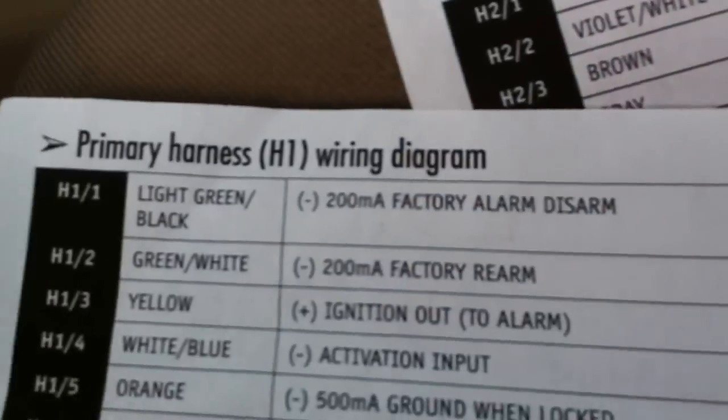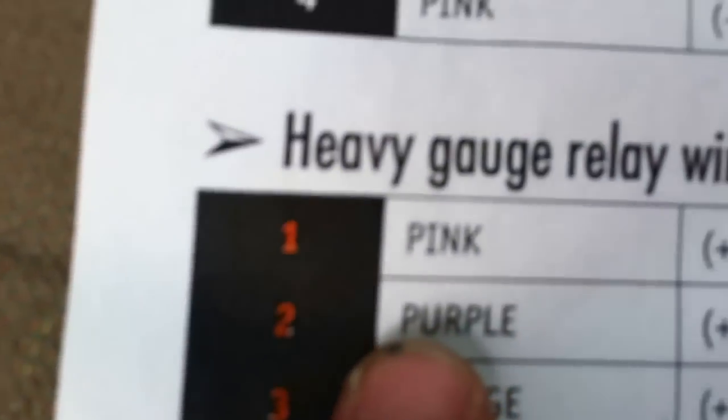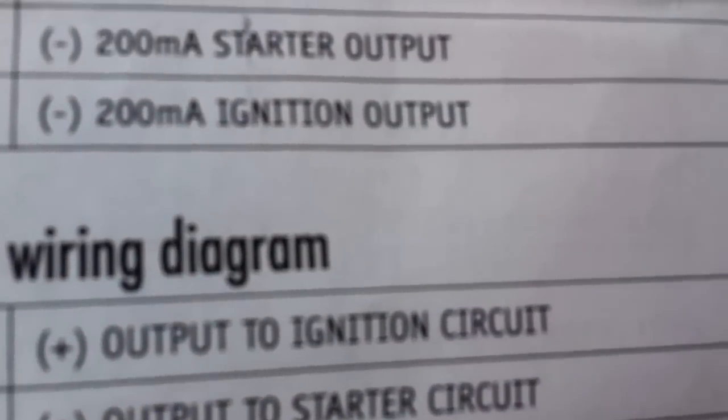Putting in an alarm is just matching two instructions. First, you go to the car, to the alarm instruction. It's like I'm looking for the ignition. So it's a pink, it's an ignition, and then I look on the car diagram wires, and I look for ignition. Right here is an ignition. You can barely see that. It's an ignition, and it's a black and yellow. So that means you've got to look here for black and yellow, which is this one, the one I got ready. So that's where I'm going to put my pink one, on the black and yellow.